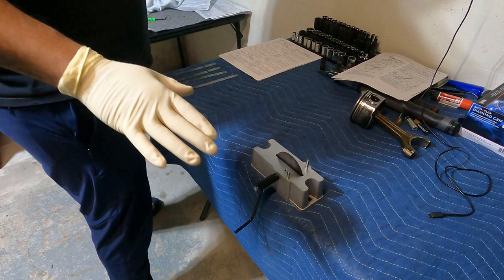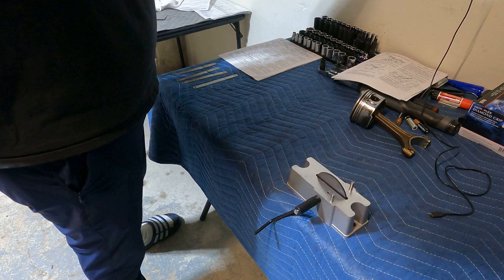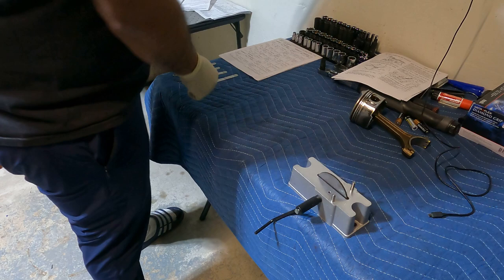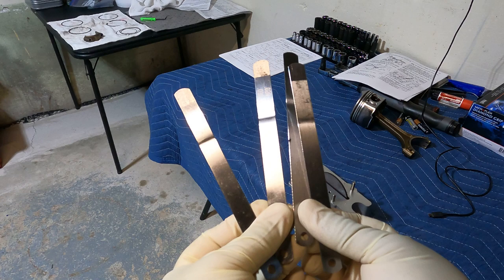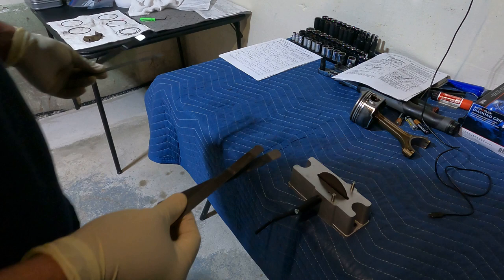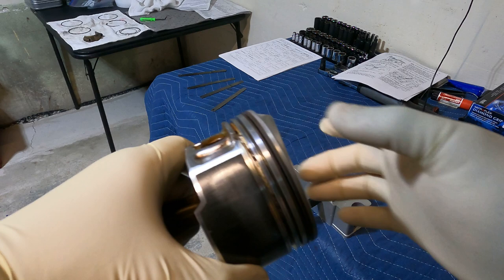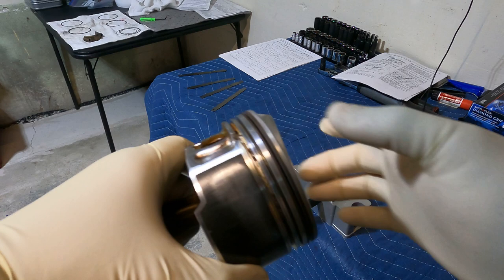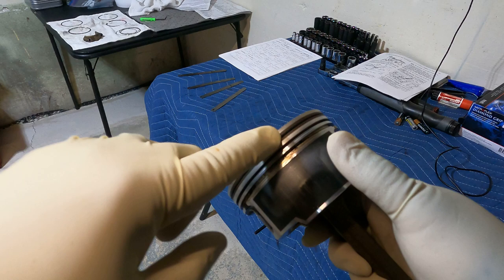We're just about ready to fit our pistons and check the ring gap. You'll need a ring file — you can get them cheap on Amazon — and your feeler gauges, basically from start to finish, to know your max gap versus your low-end gap. These are really important. If you don't have feeler gauges, don't do this. Now we've taken all the rings out of the pistons. I like to lube a little bit of oil in the cylinder so the piston slides in nicely without scratching the surface.